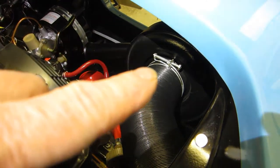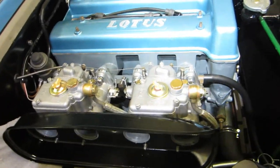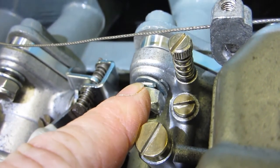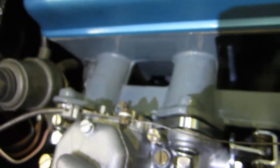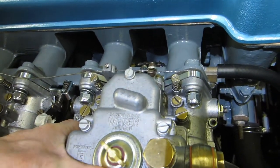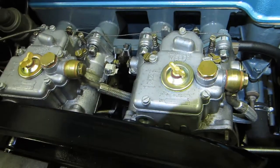I've fitted the air filter in the air filter box down there, and fitted this flexible duct hose which brings the air up to the carburettors. I've got the carburettors fitted to the engine — they fix with Thackeray washers, which are like a double spring. There's a plate with O-rings either side which gives the seal between the head and the carburettors. The carburettors can move slightly — those spring washers allow the carburettors to move, and the idea is it somewhat damps the vibration of the engine from the fuel inside the carburettors. I believe that's the idea.